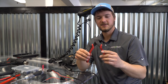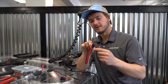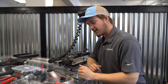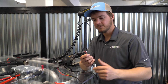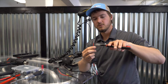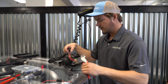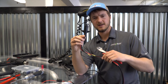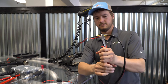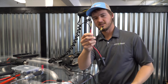I've got a set of wire cutters that are also crimpers. This tool is going to allow me to cut the heavy gauge wire with relative ease, and then use the larger crimp setting to crunch the butt splice. To begin, I'm going to take my ProNav power cable and, since we've decided not to wire it directly to the trolling motor battery, I'll remove the terminals that come on the end. Then I'm going to cut off the connector on my Minn Kota trolling motor — I'll cut on both sides of the current butt splice and remove the existing heat shrink.